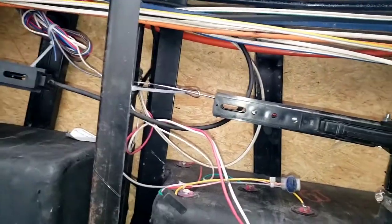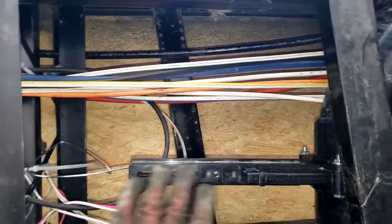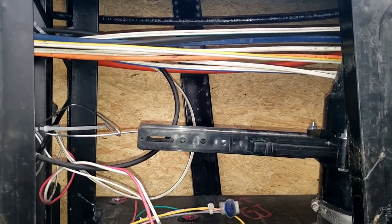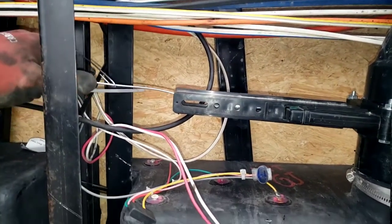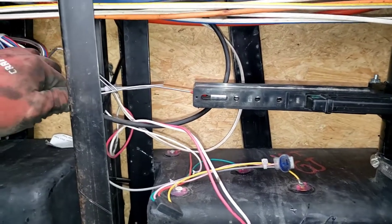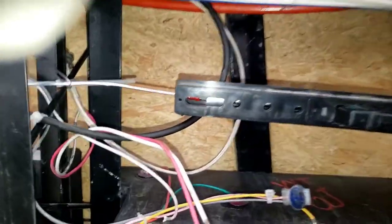What I found after taking off the valve is that I really didn't need to replace the gate itself. It flows in and out without too much trouble. That's where I made this handle, and if I pull it out you'll see where my red tape is marked — that's as far as I want that gate valve opened.